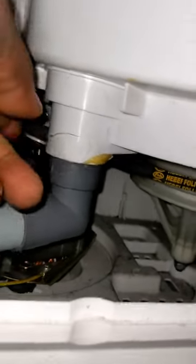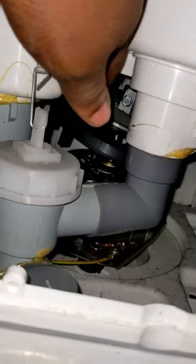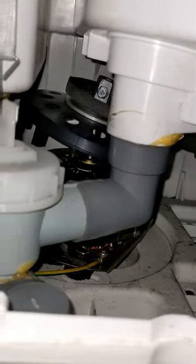The belt left the rail and ended up over here — I don't know if you can see it. Because of that, this attachment to the motor had to bend to support it. That's why when you turn it on it makes a rough noise. It's definitely not from the motor, because the motor is still intact.